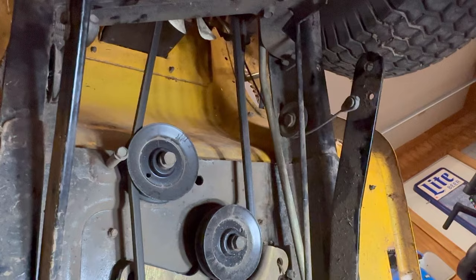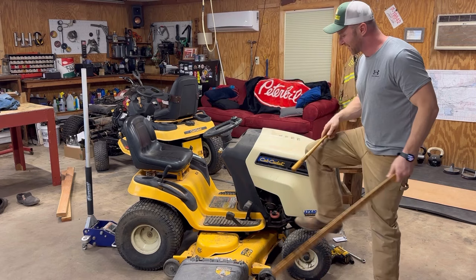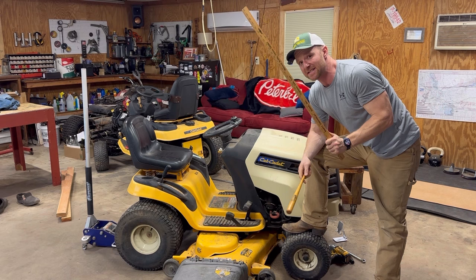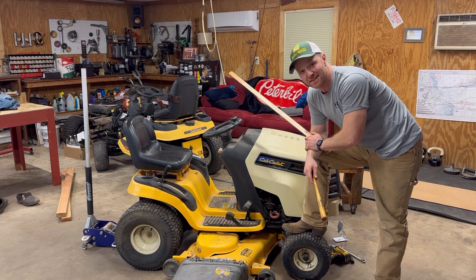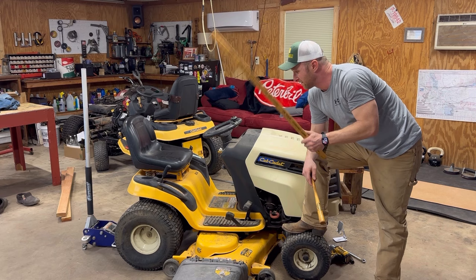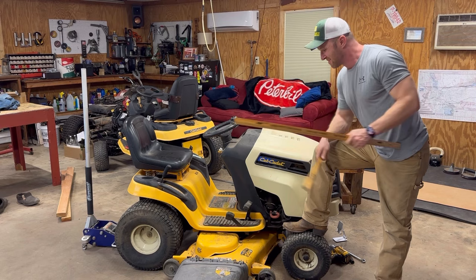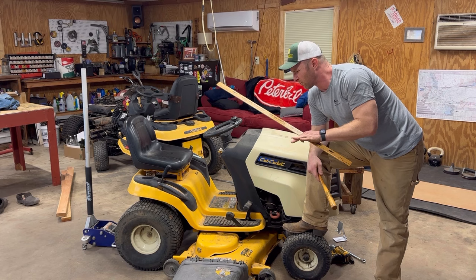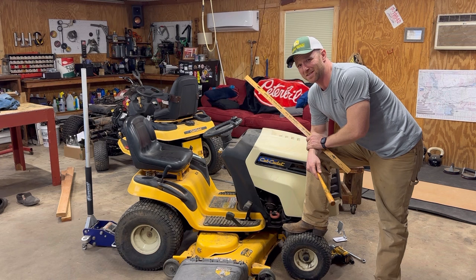Let's go ahead and wrap this video up. I think I've showed you everything I possibly can on this horrible deck system. Thanks to my yardstick and my Astros Bat, we finally got this old deck leveled out. And bending that rod like I did over there — it fixed my deck sagging issues. This deck was dragging in the dirt, so just bending it at that pivot point really helps out. If you're having issues like that, try that out. Gang, I hate this deck leveling system, but it is what it is — if this is what you've got, go ahead and make the most of it. But if you want to hear what I really think about it, I've got a great video I'll post below that compares this whole system to a John Deere, and you'll see how much better a John Deere is. I rate this thing a used 15-year-old Cub Cadet — it's kind of like a functional piece of trash. You just want it to work. Hope you enjoyed it. Thanks for the yardstick, Dr. Bob. Mower Mike's out. Bye.